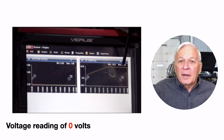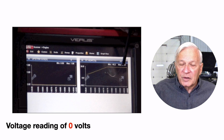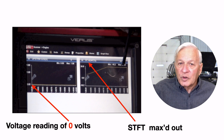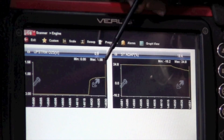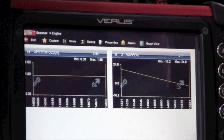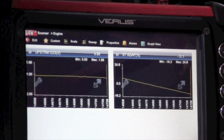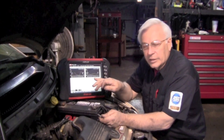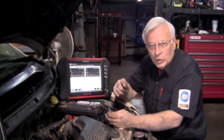What's happening here is I'm tapped into the signal wire from the oxygen sensor, which is currently sending a fluctuating voltage signal, and I am jumping it to a constant system ground. So I know exactly what I'm adding, and you can see that the short-term fuel trim immediately maxed out and stays there. When I take the ground off, the oxygen sensor starts responding again and the fuel trim comes down. Forcing the oxygen sensor to ground tells us it is capable of reading a lean condition and telling the computer to add fuel.